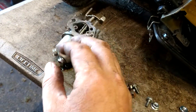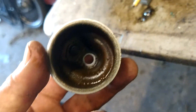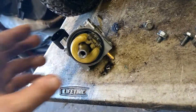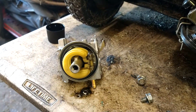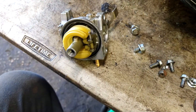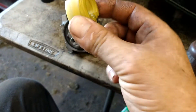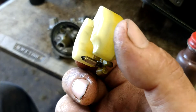To get the bowl off — you can see it's all dirty. We're going to go ahead and clean the bowl out using carb cleaner or brake cleaner. We want to pull this pin off with a pair of pliers — the pin just comes straight off. The float comes off with the needle valve. You're going to have to clean the needle valve and the float very well.